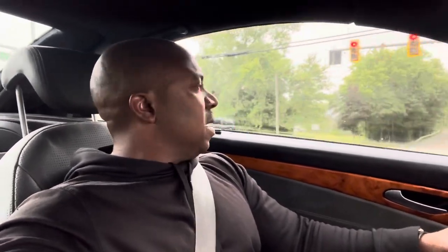It's a very powerful, even if you have a 500, it's a very powerful and nice torquey car that handles very well and feels sporty. I think with the ABC, it isolates the road from the driver so much that it does feel like a luxury cruiser. But I think with coilovers now, you feel the car more and it feels more like a sports car. So with the settings of 18 in the rear, 24 in the front, it gives it a nice controlled handling, a nice ride that feels very responsive.